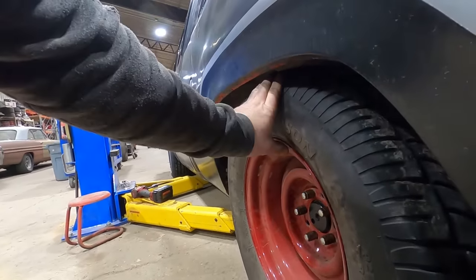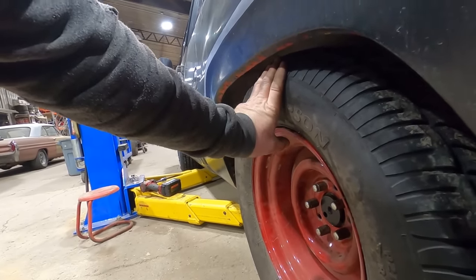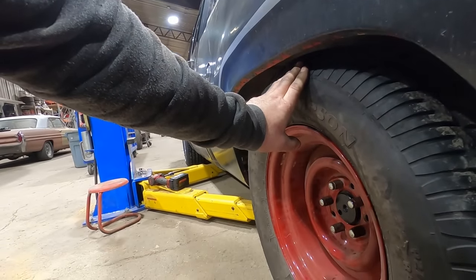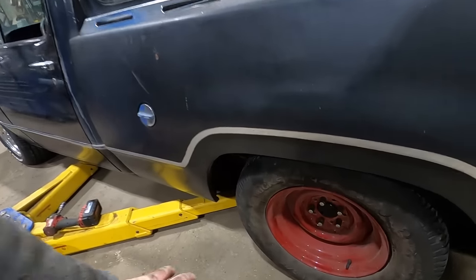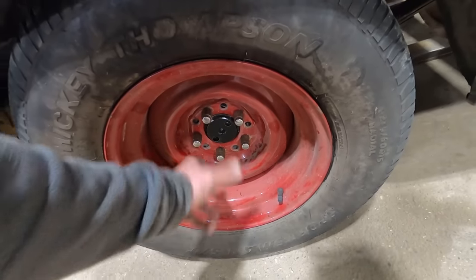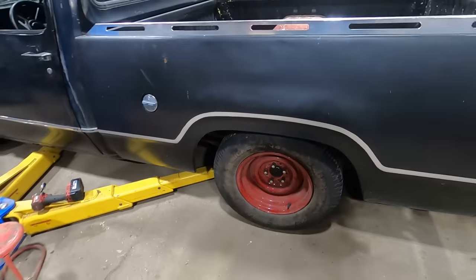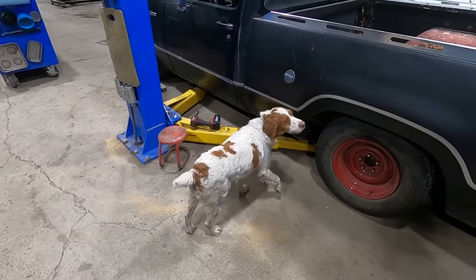Maybe we could put these on a 7 inch rim, and then with a zero offset, it should give us another half inch of clearance out here. Like I said, these wheels, they got that little T-tits in there, and those require the inside hubcap, kind of like a baby moon. So those won't accept our hubcaps. Duff's checking them out.